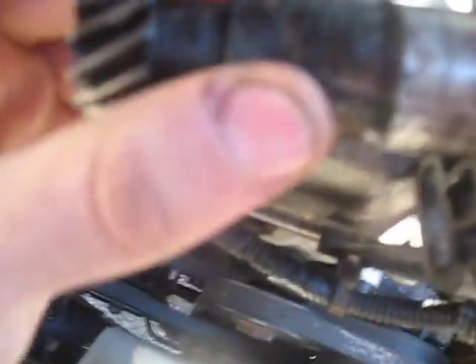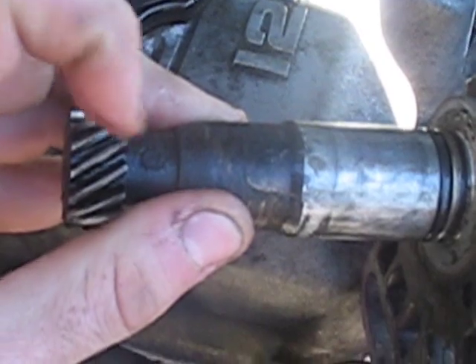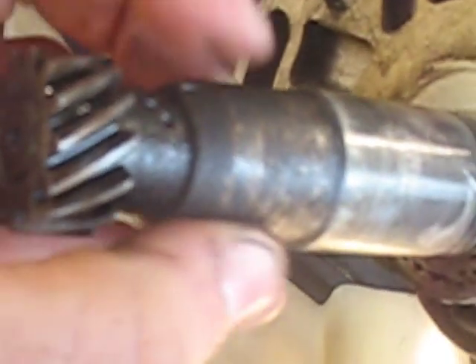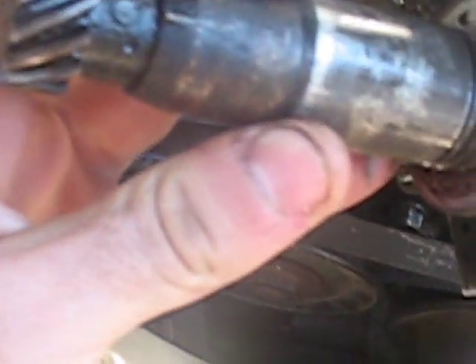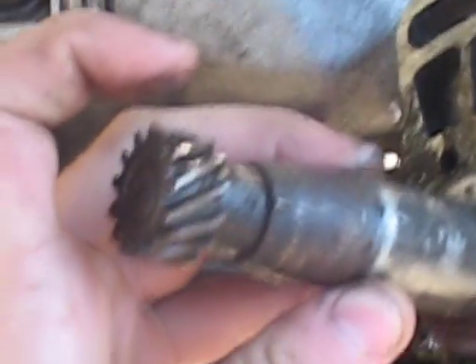The distributor here has a couple of marks. One is this little dimple here, which you can see, and another is on the housing right here. What I want to do basically is line those marks up — that dimple and then sort of a line on the housing. And once those are lined up, I can just sort of push this thing on in and it should be more or less where it wants to be.